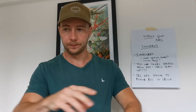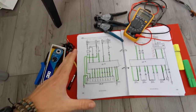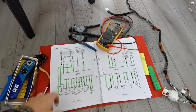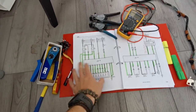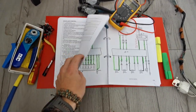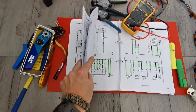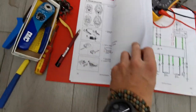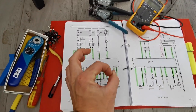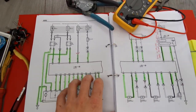This is about take five because I get a bit enthusiastic when it comes to tools — no innuendo intended. The number one most important thing you need is wiring diagrams. These are legitimate Toyota ones — you can get them from Toyota, they're awesome. They're not scary — they look scary but they're all broken down by system, really easy to follow, and they even tell you how to extract pins from all the different connectors. So that's what you need: the exact wiring diagrams.